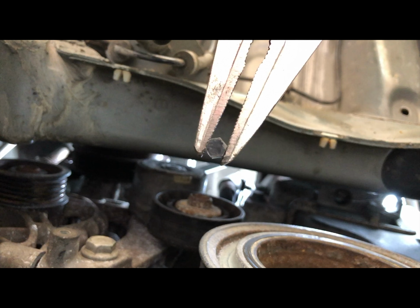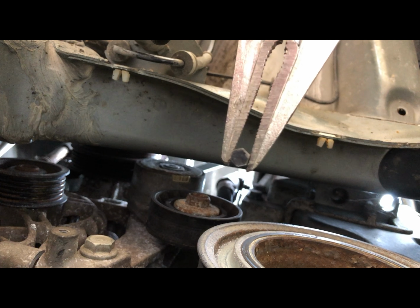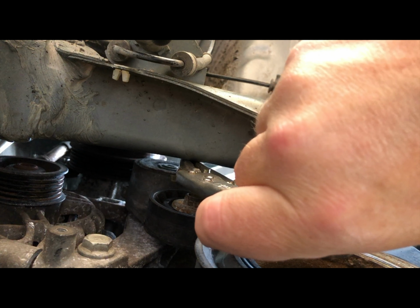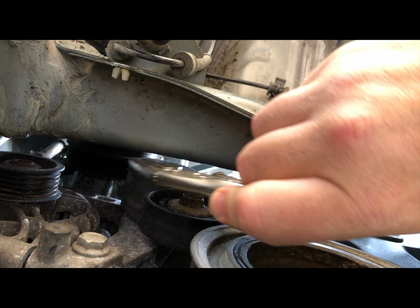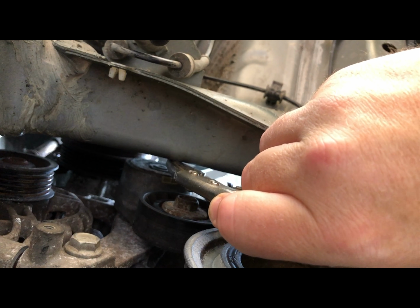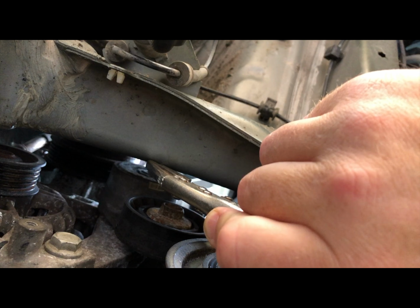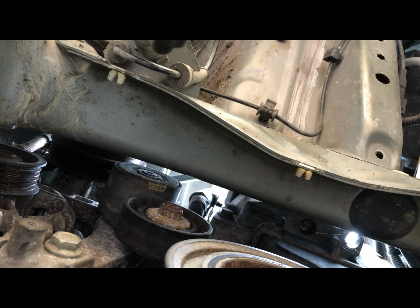Like I said, it's 8mm, 7mm. Basically, I've used an angled Allen key, an L-shaped wrench, and just chopped a little bit with a grinder to get just into here, and then turn that bolt out from the engine, because you can see not a heck of a lot of space, even when I've loosened the bottom engine mount and the lower control arm ball joint from the wheel hub assembly. Not a lot of play, so you just need to be patient and take your time.